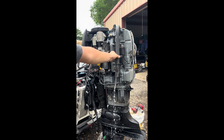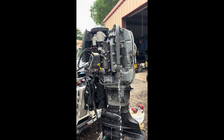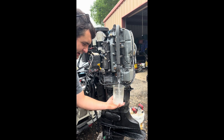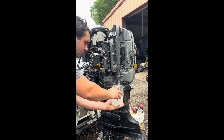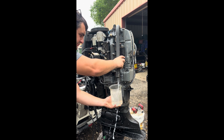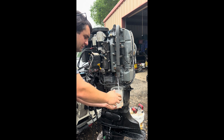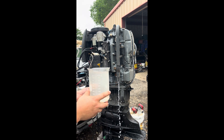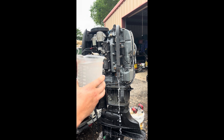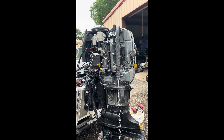I'm going to pull this off the harness — it looks like the thermostat's opening at two minutes. Now we're getting hot water out of there, and you can just look at how much faster that water is coming out — we're flushing it out. Within seconds we fill up a third of a gallon. So this looks like a good test.